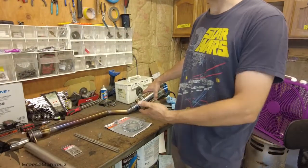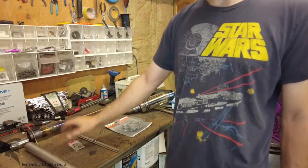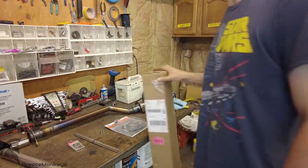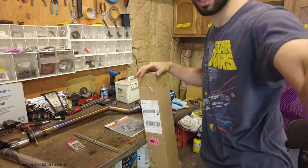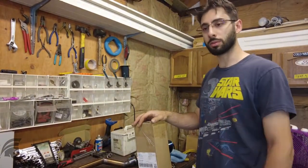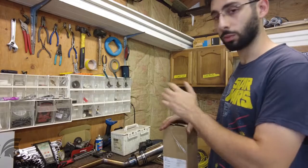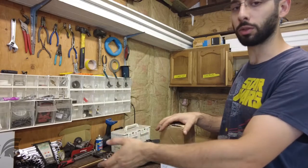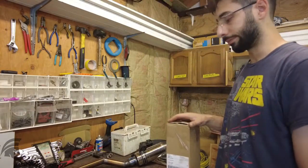So we're going to take my exhaust, choke cable, some stainless rods, stainless spacers, stainless washers, and more stainless too. Oh, and more 4-inch stainless tube. And we're gonna make an exhaust cutout and a muffler so that when I choose to, we can be somewhat respecting of people's sound ordinance. What? We can be nice to our neighbors when we want to, and then we can be really mean to them when we also want to. So, yeah, custom cutout and muffler, because they don't make a stainless muffler with 1.5-inch inlet and outlet that fits in this short span. So we're gonna make one.